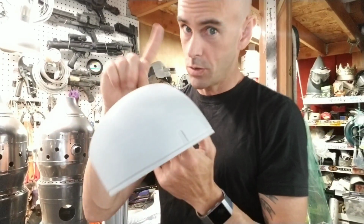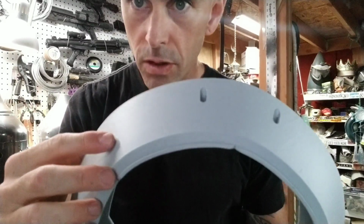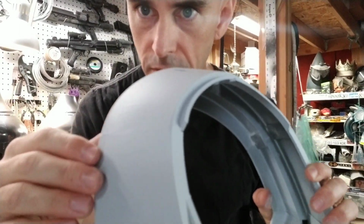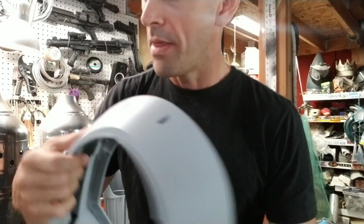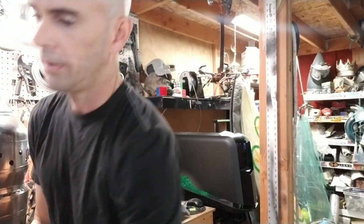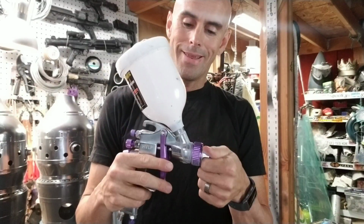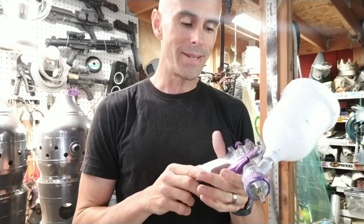And this is just one coat of the auto primer. So this stuff is really good. Now, right out of the gun with no sanding, it can get a little bit of a texture, as you can see here, that is more prevalent when I use a paint gun like this. This is an HVLP gun, which is high volume, low pressure, and this one shoots about 30 PSI.